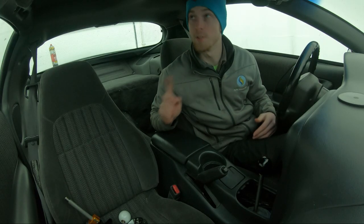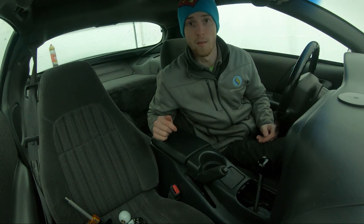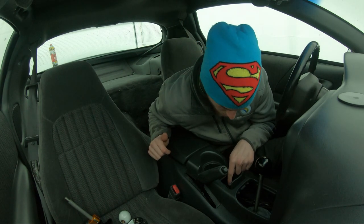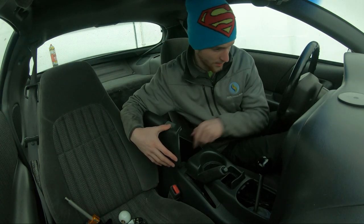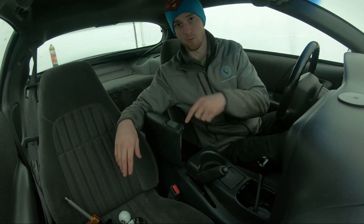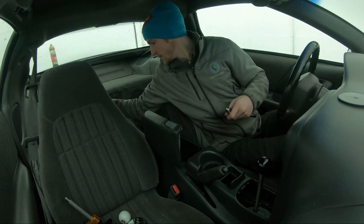I was going to put the camera on the t-top, but I have the little carpet things on there and I'd have to take the t-top off to put it up there. So first thing I have to do is take this piece off. There's one bolt down in here and then there's two back in here, and I think the front just actually pops out. You'll have to unhook your cigarette lighter and everything, but that's no big deal. I have my tools sitting in the back seat.